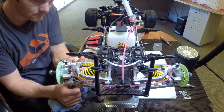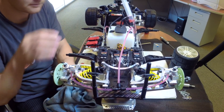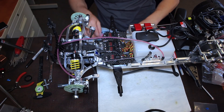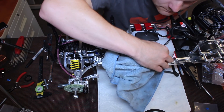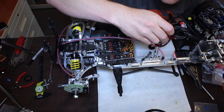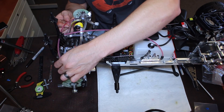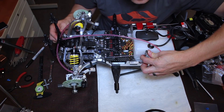When you cycle the master cylinder, inspect those valves and check to see if you've got any weeping of brake fluid, because that might indicate you're not completely tight. Also, once you do cycle the master cylinder for the first time, you're probably going to force a couple of air bubbles out. You're going to see in the video as I operate the master cylinder with the little brake lever — a couple of bubbles start forming. So you'll just have to re-bleed the brakes.